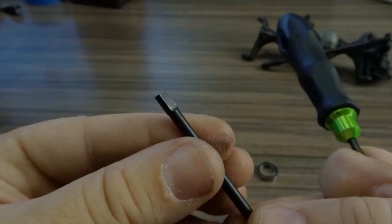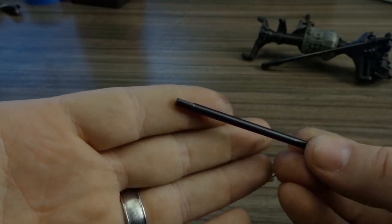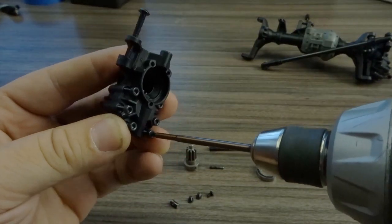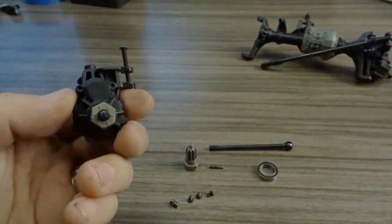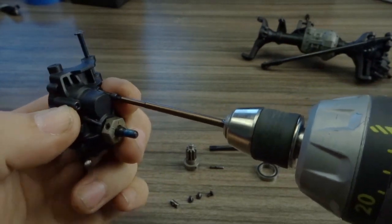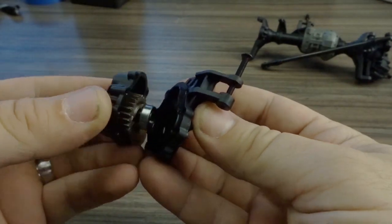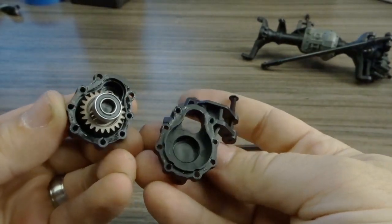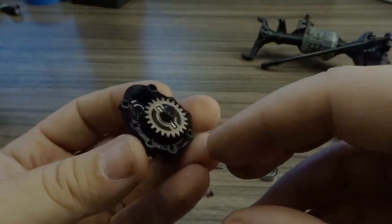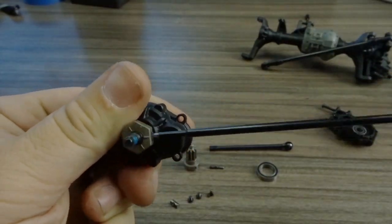That's a pretty standard CV type design. You can see the tang on the inner axle shaft. These inner axle shafts are pretty small in diameter but with the reduction from the portal boxes they're not under all that much stress. Remove the six screws on the back of the portal and the two screws on the front of the portal to separate the two halves of the portal box, giving you access to the inner remaining gear still in place. You can see here the bearing sizes on the portal axles are much larger than normal wheel bearings you've seen on standard solid axle trucks.